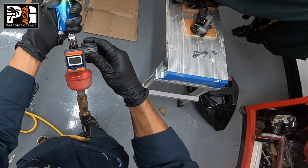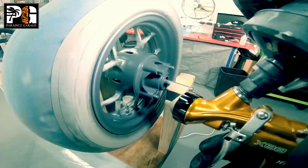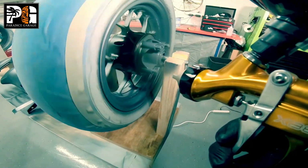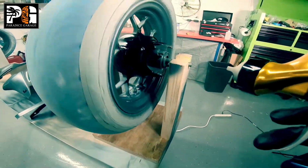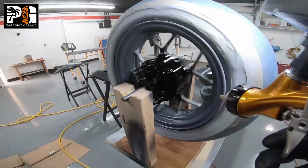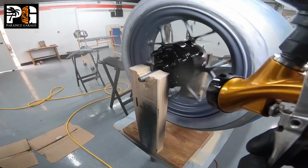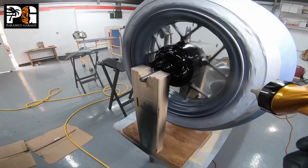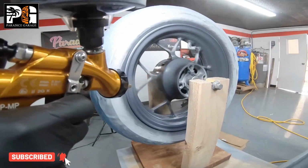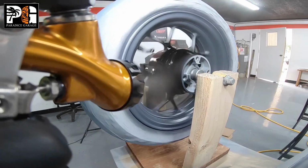I put this video out about a week ago, and I just wanted to cut it down and get to the gist of it. So what we're doing here is basically spraying candy rims. We're going to be doing a black base coat fade and putting the silver base coat on it. Whenever spraying candy, you always want to spray candy over a silver base coat. It could be a darker silver, a super bright, something with a lot of metallic or a little metallic, but spraying candy over silver is the best because that's when it literally shows the candy.